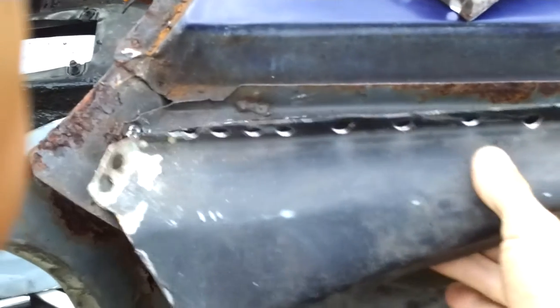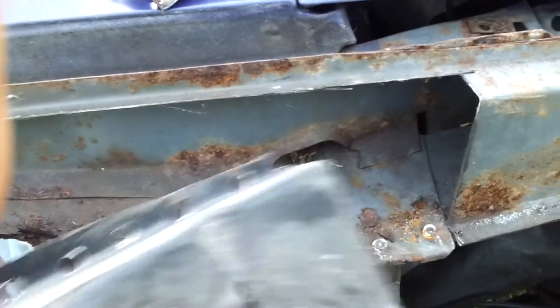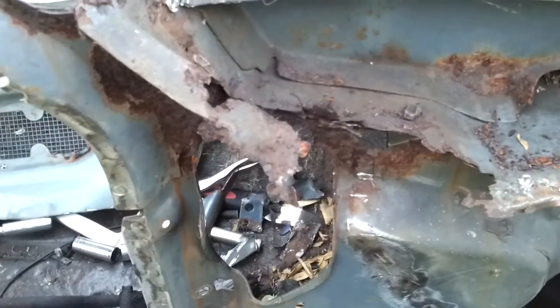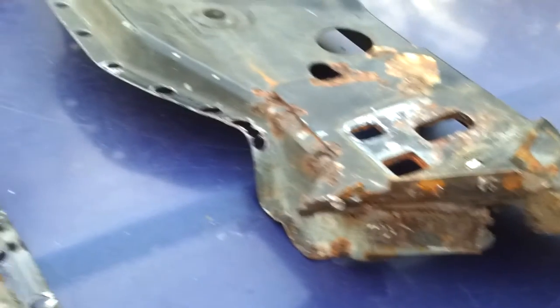I have a new piece — or a new old piece — and I'll trace it because this still has some rust right there and then I'll fix that. Then I'll just fill in all the spot welds. At least it gives you an idea, if you're wanting to get into fixing it, what you're looking at. It's not that hard — a little time consuming. The hardest part is just drilling out all the spot welds because there's a spot weld every inch, inch and a half. It's going to be easier to just get a parts car and cut it out and fix it a little bit versus trying to make the whole thing.